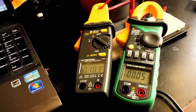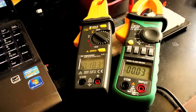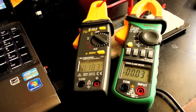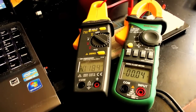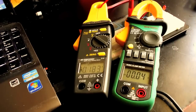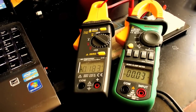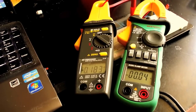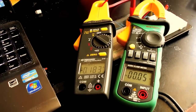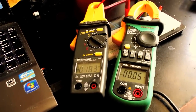They may have hooked the refrigerator in, the control board, because all the appliances, the refrigerator, the water heater, and the furnace, all of those devices, even if they run on propane, have DC control boards on them. So there's quite a few things going on that could draw the batteries down. And the only way you're ever going to figure them out is if you use meters like this and do an analysis and find out what's discharging and what stays on when you turn the battery switch off.